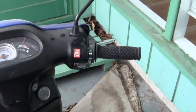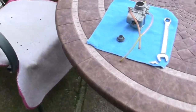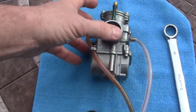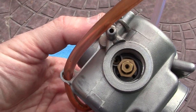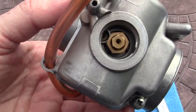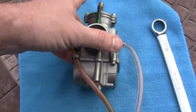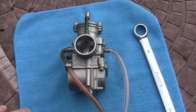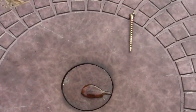So if your bike is idling, it means that your idle jet is clean — that little tiny one off to the left. If it will not run after 30 seconds, it means that the main jet's clogged. It's very easy to fix; it's the most common problem ever in motorbikes that have been sitting, because they get this sludge gasoline in them.